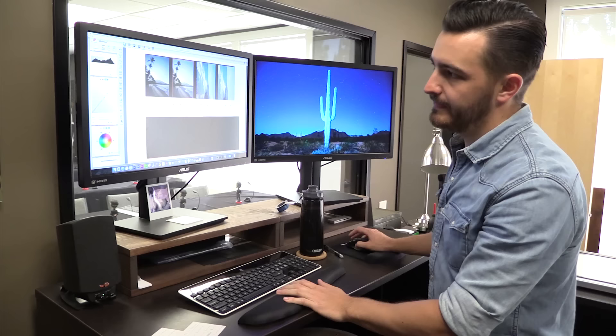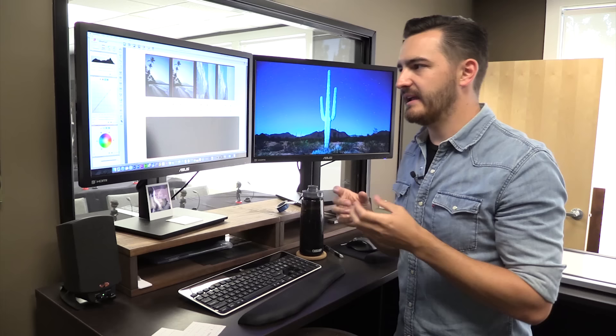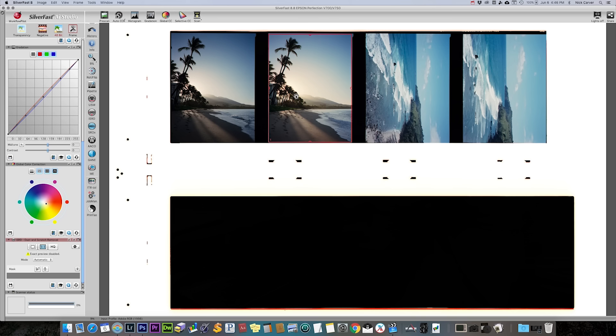One other tool I'm going to use is ISRD — that's Infrared Scratch and Dust Removal. The Epsons have a really cool feature where they can scan at an infrared wavelength, which can be used to basically eliminate dust from your picture. When you turn on ISRD, when you make your scan it's going to make two passes: the first pass is the regular scan, and then a second pass using the infrared wavelength of light. Using that infrared wavelength, it can detect dust separate from the image, make a map of all the dust on your picture, and then subtract it. It has really increased — or sped up — my post-production time because I'm not spending nearly as much time cleaning up dust. I recommend using ISRD; it increases scanning time a little bit but it's worth it.